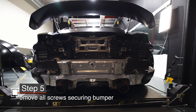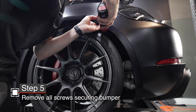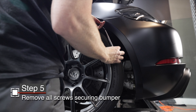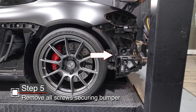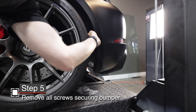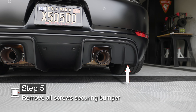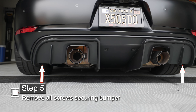Now let's remove the last of the screws holding the bumper on — this is the same for all models. First, there's one holding the bumper to the fender. This one may be hard to get to; it helps to raise the vehicle so the tire drops a little for easier access. Remove that on each side. Next, go to the rear section of the fender liner — there's a screw in each. Then right under that, going upward, is another screw on each side. Lastly, there are a couple more screws closer to the middle, just outside of the exhaust pipes.